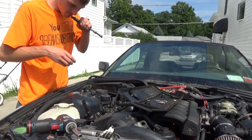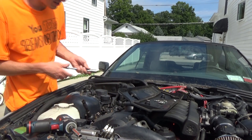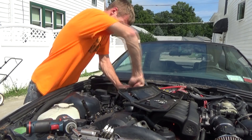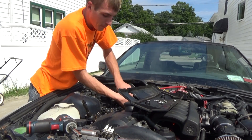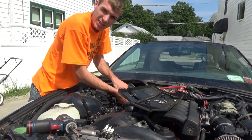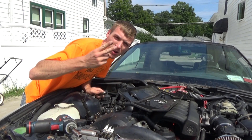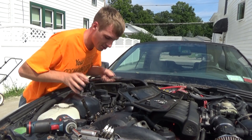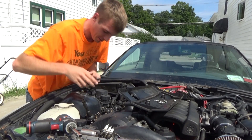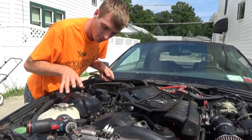Four cylinder — NGK. Four for four NGKs, three out of four not burning. This is actually exciting. So far it's not looking like it's going to be a computer issue or an electronic issue. These might need to be replaced, but chances are it's probably just spark plugs and a good cleaning. If you don't know much about engines, there are three things that you need to have an engine run: air, spark, and fuel. Really basic. All this electronic stuff — don't let it deter you, it's quite simple.